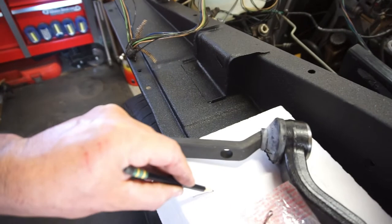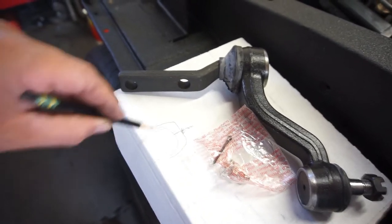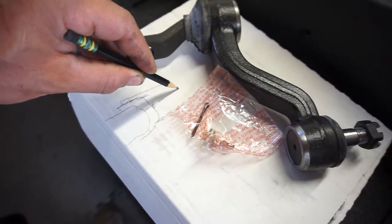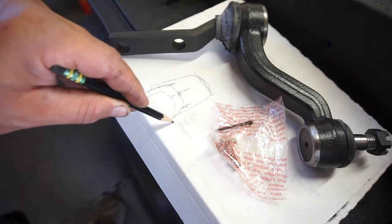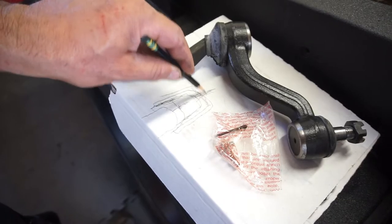Anyway, I'm gonna take that shock hoop, and I'll just draw a little picture real quick because I like drawing. So right now, doing this left-handed, so I have the shock running through right now with the nut, and then these are threads, and then, you know, the shock is like this. So what I'm going to do is I'm gonna have to cut this out. Cut this out and take some strap, probably weld strap on, like my toolbox. Probably weld a strap, bend some strap like that, put it on like that, and then this way the shock will attach in here. So I'm gonna bring it up about 2 inches and go from there. So that'll have to wait to another video.